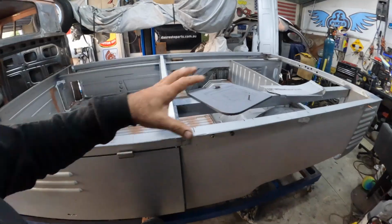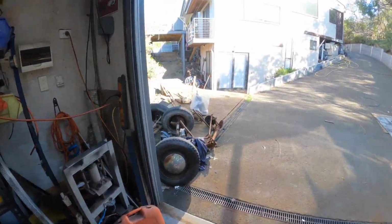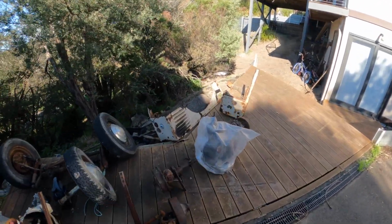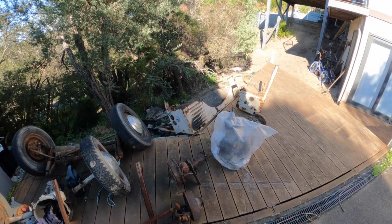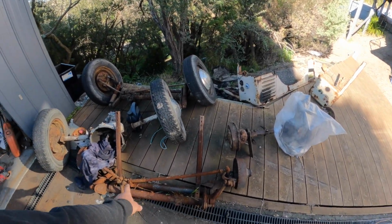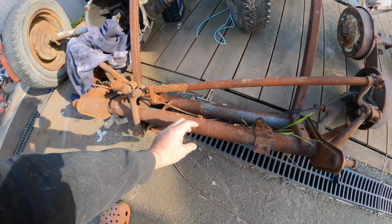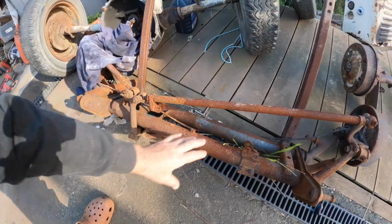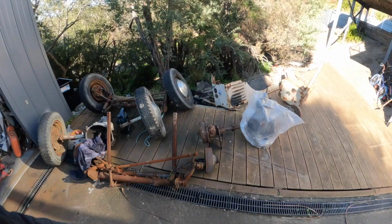So that means obviously gearbox, front beam. We do have both. Now, I wasn't going to run the original gearbox, but I think we are going to, because I think we're not going for a 3-inch lowered bus. We want it just a little bit lowered from stock, so I'm going to modify the boss plug, or the little parts inside here that rotate with where the splines are. We're going to actually drill these out and modify that to drop it, because I don't want to do drop spindles on it. This is going to be too difficult being a Barndoor.